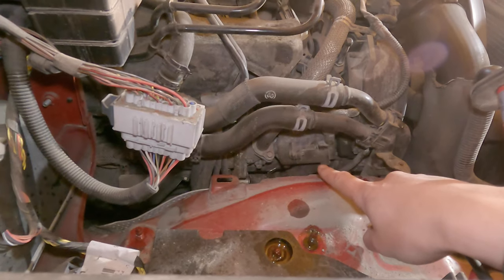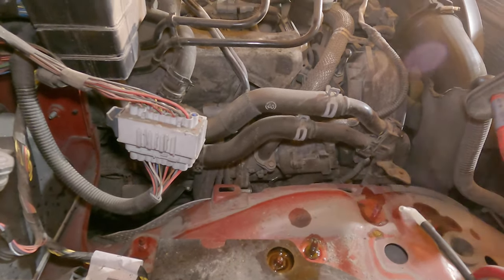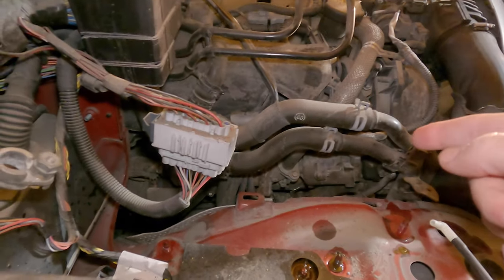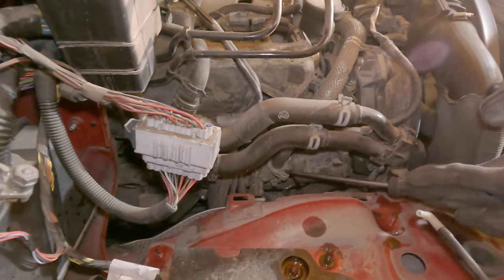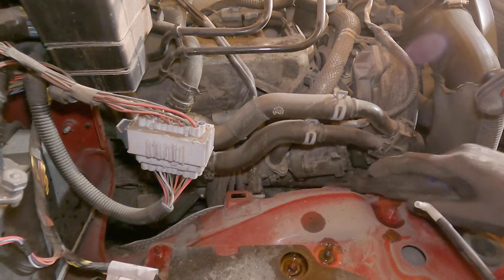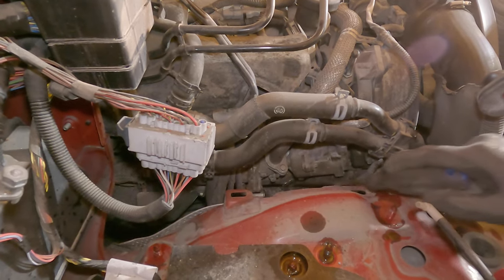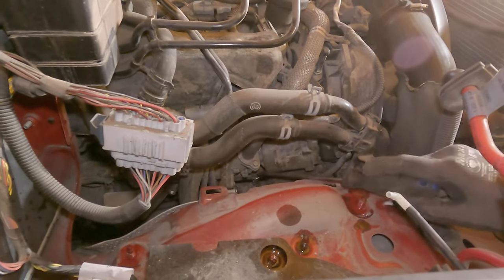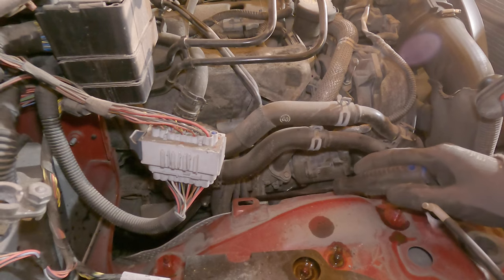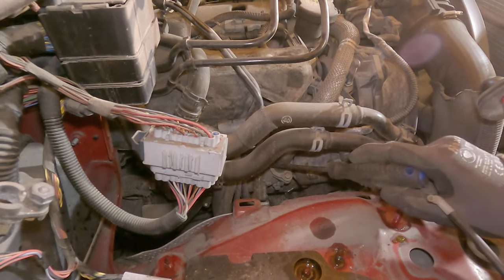Now it's the EGR valve. And the most difficult part is the bolt on the other side. There are two nuts on top holding the pipe, and there are three screws. One, two, and the other one is down there too, somewhere. And you have two Torx, I think Torx 30, from this side and this side from the cooler.